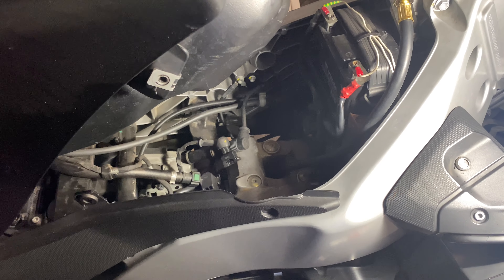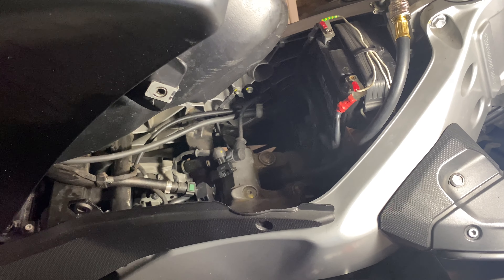I'm happy to say 200 PSI — excellent, everything's fine on mine. I hope that helps somebody and gives them an idea of what they're looking for. Just to finish up — when I was talking about the compression ratio on my bike, mine was 12.5 to 1. To find out what PSI you should be getting when you do the test, just multiply the compression ratio by 14.7.